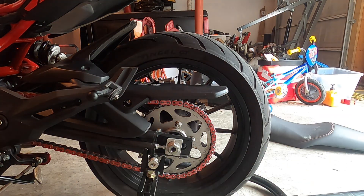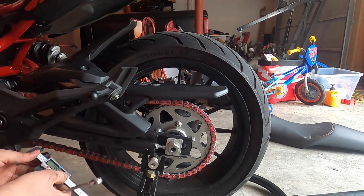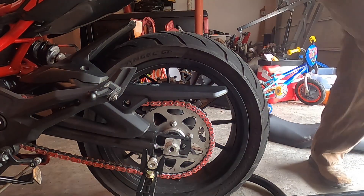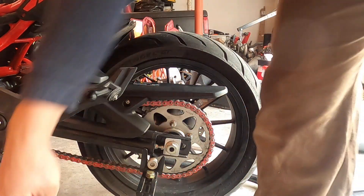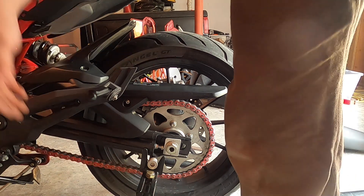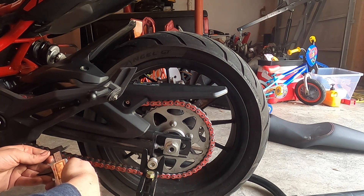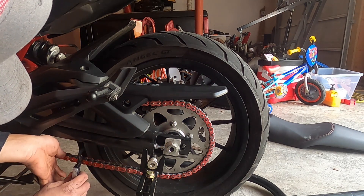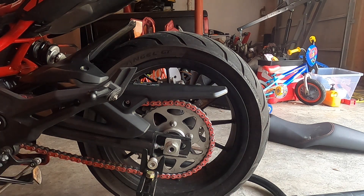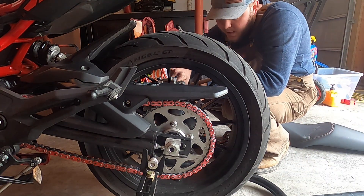The chain is really tight now, which is good — it means we're doing things. 22.5 on this side, 22.5 on this side. That looks like pretty good movement. We're shooting for around about 30 millimeters — that's pretty good. So now we've got those done. We're going to tighten this back down and run the set nuts back in place.